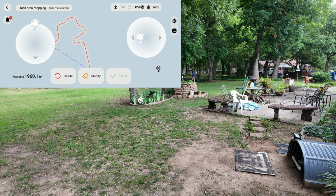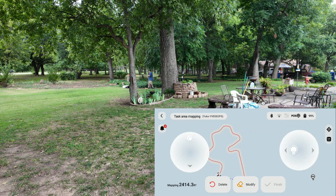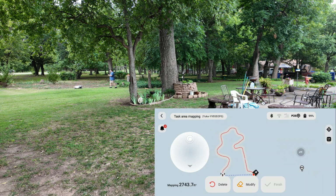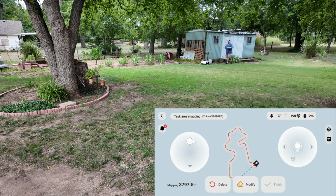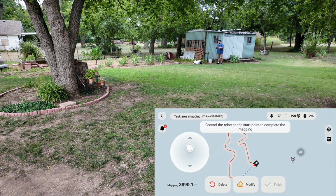You know, even when you think you know everything, you can always be humbled. This episode is going to go from me thinking I was proving Yuka having a problem to an episode of RTK placement is key. You really got to have excellent coverage. All the people that think it's okay to put your RTK station in the attic, now I hope you can see that signal quality really means a lot. Even though you're receiving 40 satellites, it doesn't mean you're receiving 40 satellites well. So even just a few leaves above the RTK station caused Yuka to miss multiple rows and have a lot of signal loss. Wide open spaces is key to the RTK success.